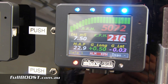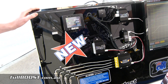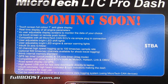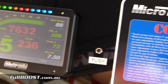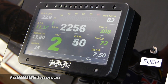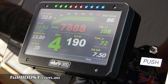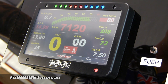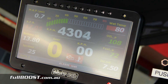This Dash is really great, but there's a brand new one coming out very soon — the LTC Pro Dash from Microtech. As you can see, the screen is much, much larger, but not just that. Let's run through a few of the extra features. We've incorporated turn signal indicators, a high beam indicator and an odometer into this unit. Those three features allow the Dash to be ADR compliant, so guys who have a street car where they've removed their factory Dash — the Microtech Pro Dash will allow them to just have that Dash mounted without needing any other components or gauges, and the car will be able to be engineered and street legal.